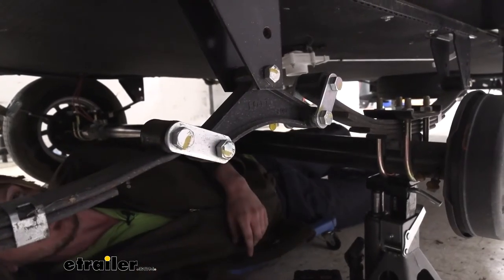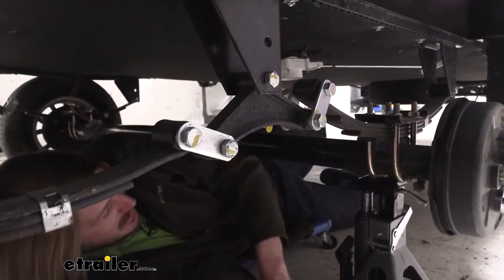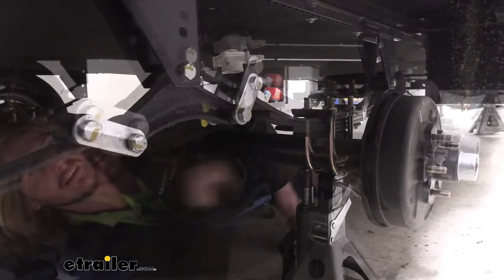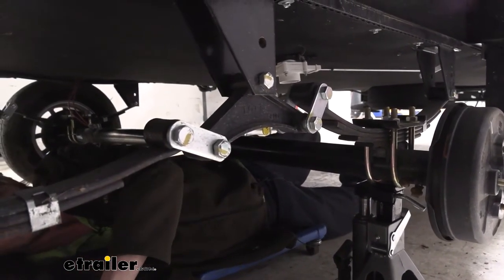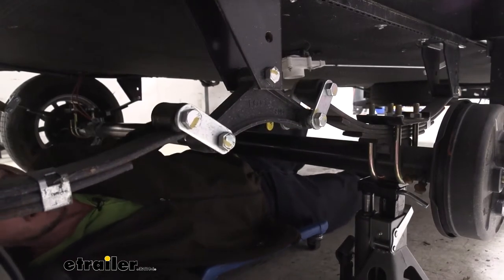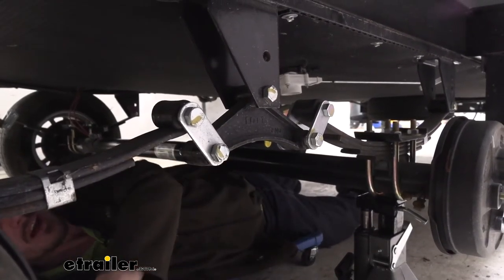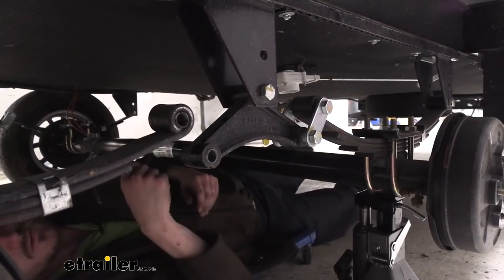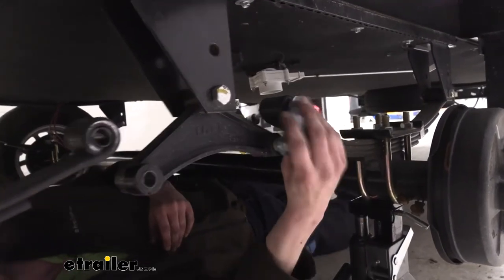After you remove the pair of nuts, these pieces typically just slide right apart. If it's not coming out super easily, we probably need to adjust our jacks a little to let them line up better. We might loosen the front axle just a hair — as it comes down, it often brings them closer together. We're just trying to find the sweet spot where these two pieces sit freely so they can slide out. Once you find that sweet spot, you'll get good play and it pops right out. We'll repeat the same on the other side — remove those nuts and pull that back piece off.